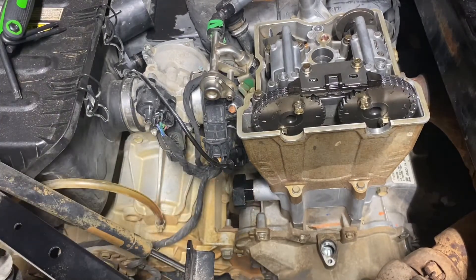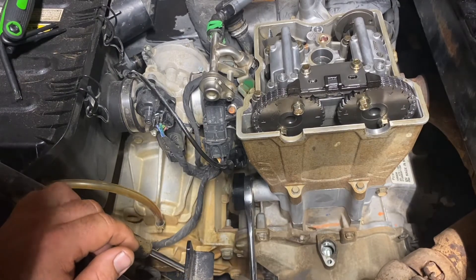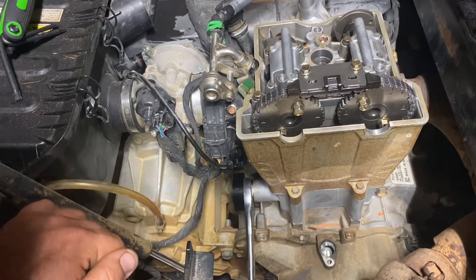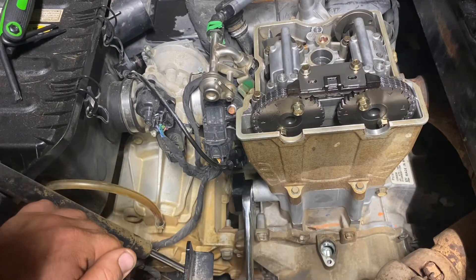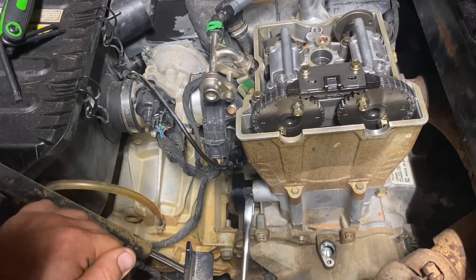Now that the adapter is in, take your inch and 1/16. There is a torque spec — in my case it's snug but not too tight. You don't want to break the thing off in the jug; just enough to crush that washer.